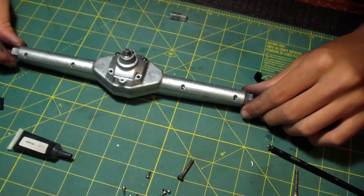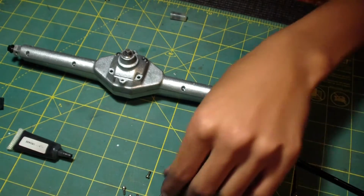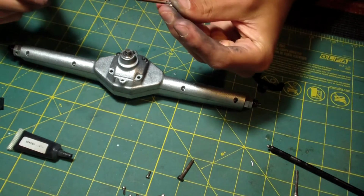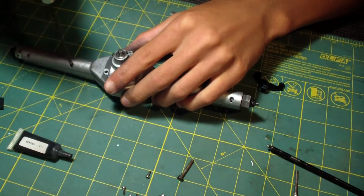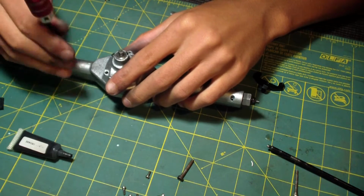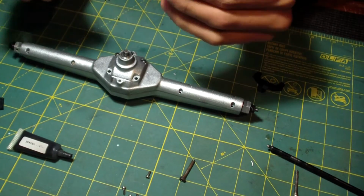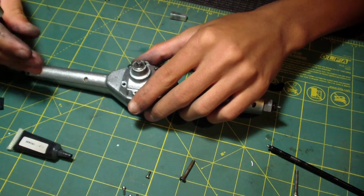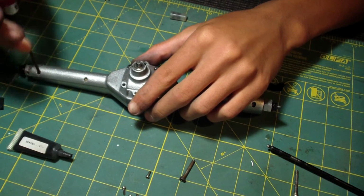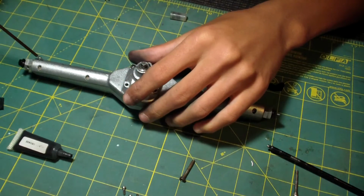Alright, so I got the 2 main screws in to keep it closed, so I'm just gonna show you me putting in all the other tiny little screws that it has on here. It has just 6 of these 1.5 screws. You really don't want to over tighten these because these would be a real pain to get out if they did strip, so I just put them in there lightly because it's really the other screws that are holding this thing together, not these little ones.